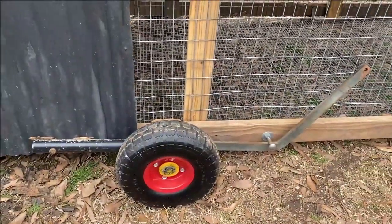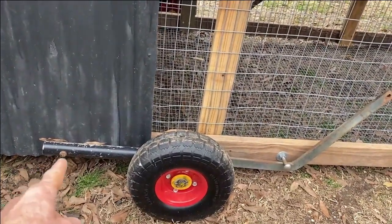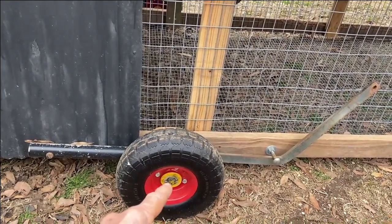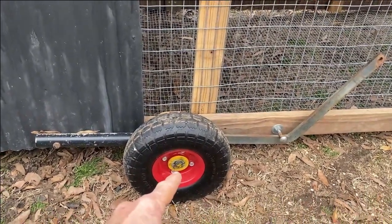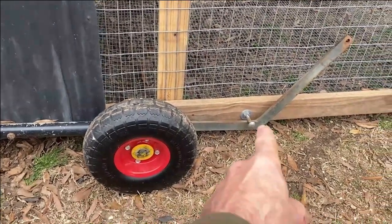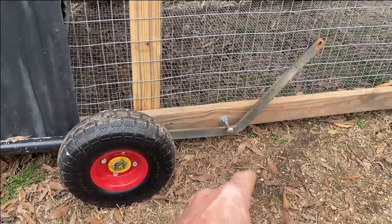There's a little better close-up — you can see where I put the bolt back through the frame, the pipe with the five-eighths inch bolt on it. That's the size of the diameter of the hole for these little 10-inch tires, and I got a bolt that the lever hangs under, put through the frame. It works just like that on both sides of the tractor.